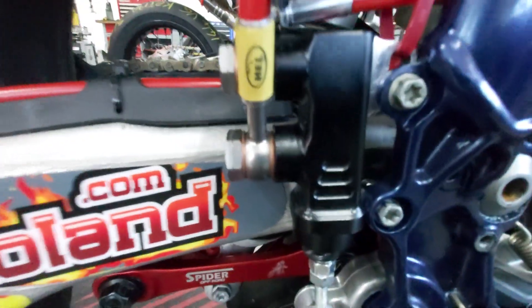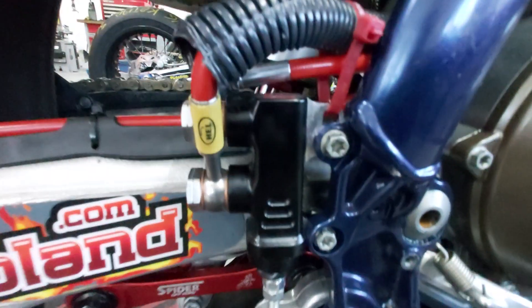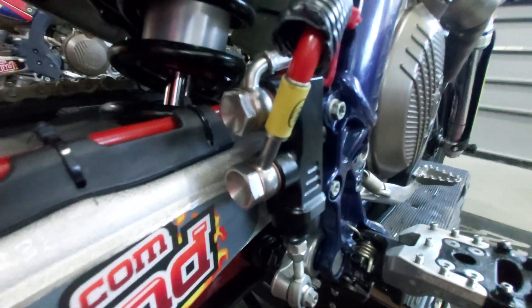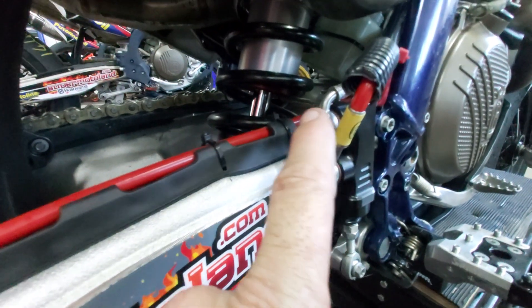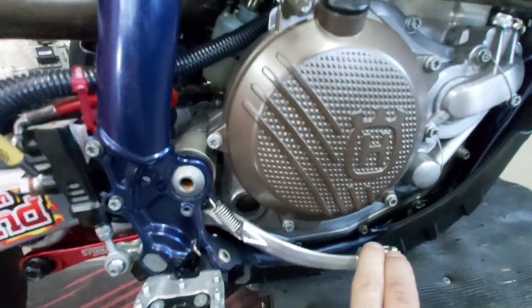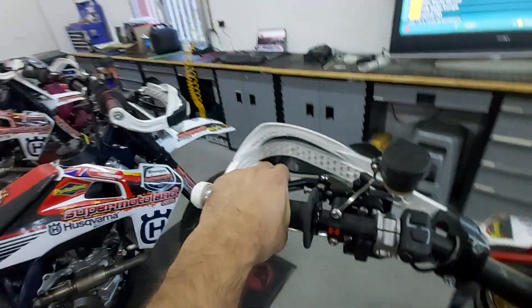That's the first thing we're going to test. We've got one of these master cylinders from Hell — you can see the little logo on the top there. This is their twin port dual port, so the line coming in here is from the finger brake and then this line is going back out and down to the rear caliper. The idea is that the rider can use either the foot pedal or the finger brake — he's got the option of both.